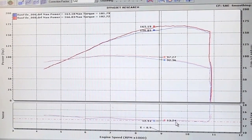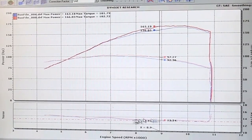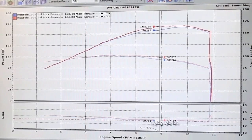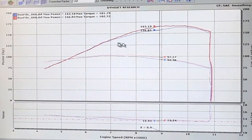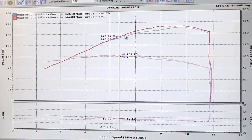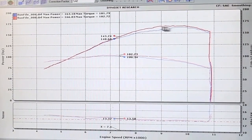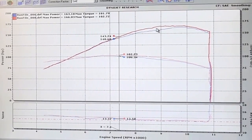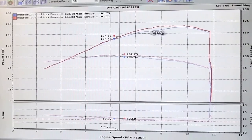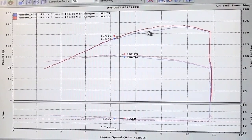Down here, the air-fuel ratio went from 12.9 up to 13.2. And 13.2 is what we're looking for at 100% throttle in the upper RPMs. Now, if I move the cursor out of the way, look at the average gains that you pick up in here. You're going to feel this type of gain — this is a seat-of-the-pants gain that you will actually feel when you ride the motorcycle. And if you look at the curve previously, see how it's sort of flat in here?